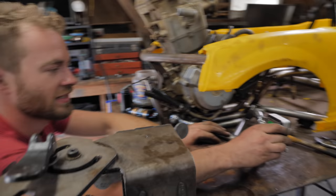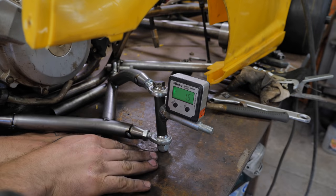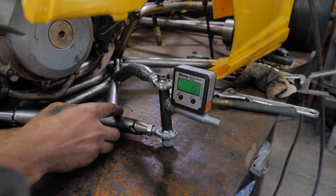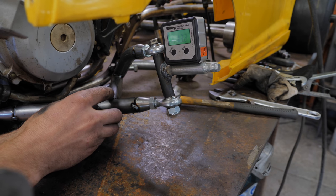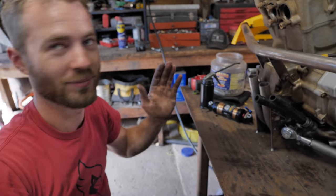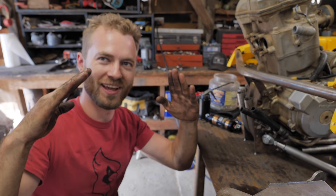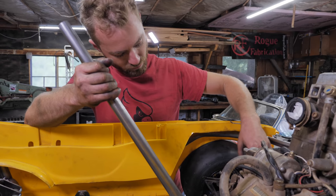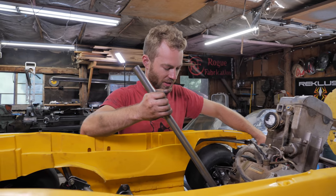I've been measuring things and that's essentially as low as the suspension will ever travel right there — 1.5 degrees out at the top. Traveled all the way up it'll be around 13-ish degrees cambered in at the top. So when it's dropped all the way down, sitting on the frame, it's going to be cambered right into the fenders. I could go forward with the shock, but I want to make sure I can make the steering work first, or I might have to redo this whole thing.